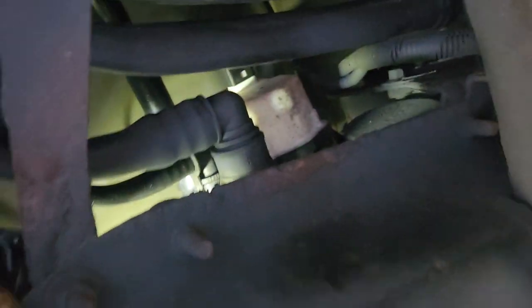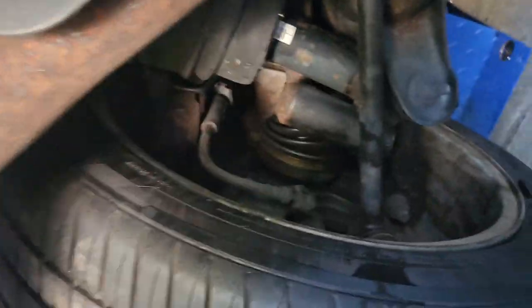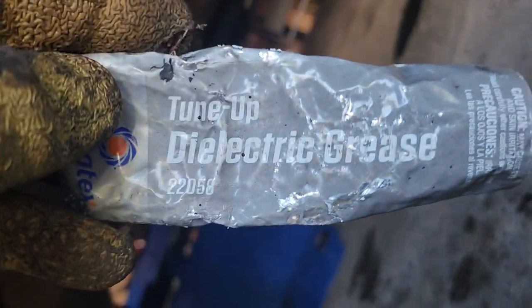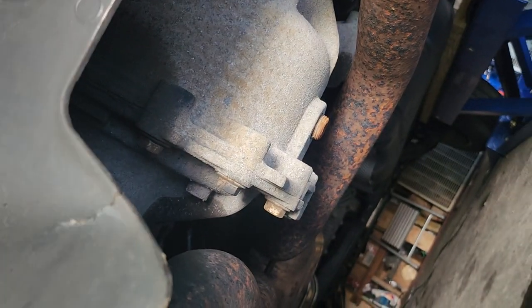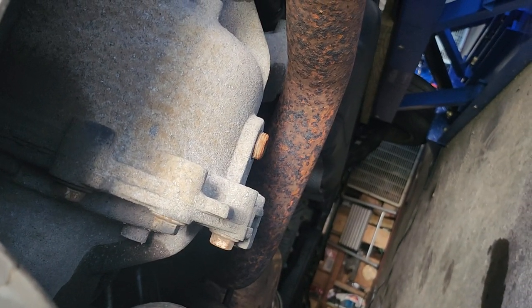The basic thing I did was unplug the harness, use electrical contact cleaner — you can buy it from any parts store — and I also use dielectric grease on the connectors, then put it back. I did the same thing to the purge valve: disconnected that and cleaned and greased those connectors as well.